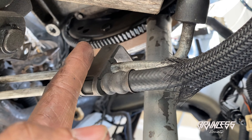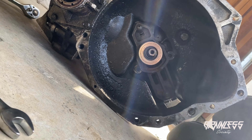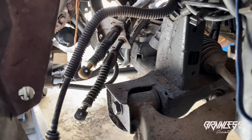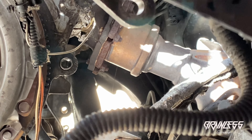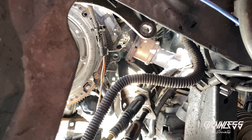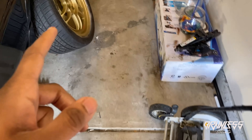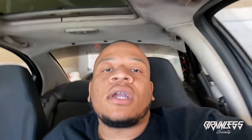Honestly guys, after that I'm gonna be able to put this transmission back on. I do have to go get a haircut in about an hour or two, so I gotta come back over here anyway. We got the clutch put back in, it's lined up, I got the bolts put in the back. I'm just gonna call it quits for right now - I gotta go grab an 18 mil wrench from O'Reilly's or something. I am back from my haircut and I've already gotten started. I went and grabbed that 18 mil - I just got the clutch tightened up to the flex plate. I had to use the jack pole to hold the entire assembly in place because once these things are tight the whole assembly just wants to spin. The jack just holds it into place to make sure everything's tight. I'm gonna go ahead and start working on getting this transmission lined back up to get it thrown back on the car.